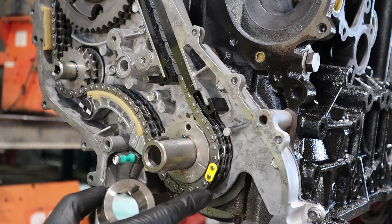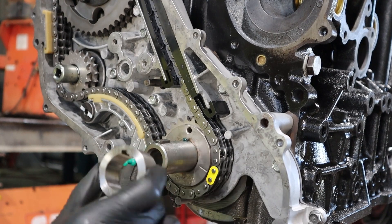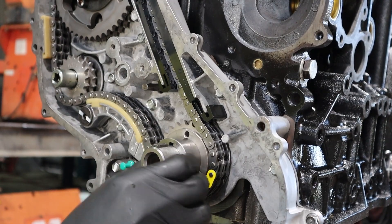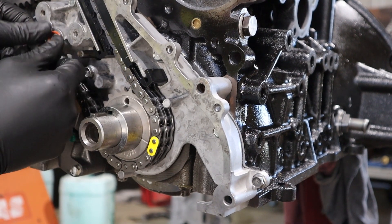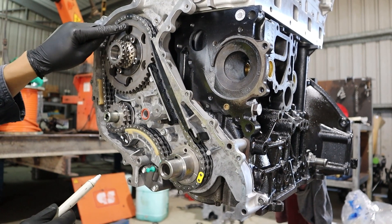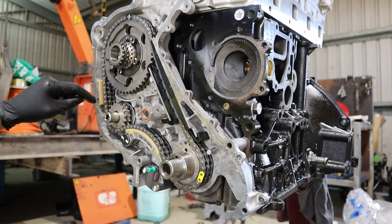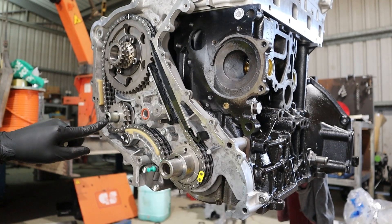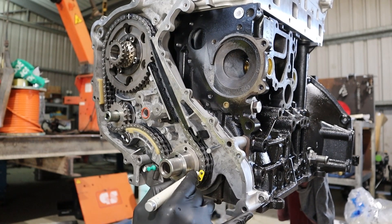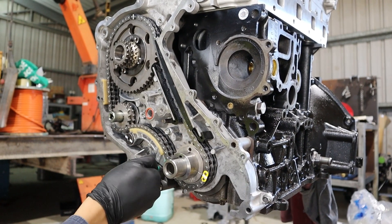This engine has been balanced with the balance shaft removed, and a grub screw fitted in the balance shaft oil feed. So instead of the crank helical gear, fit the crank spacer collar and install the red o-ring. Final check on the bottom section: dot lined up with the blue link, all bolts torqued, vacuum pump torqued, guides in, o-rings in. Now you can pull out the tensioner pin and remove the fuel pump pin.